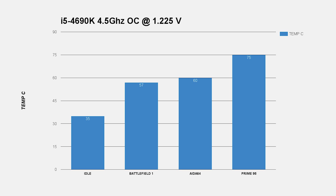Moving on to CPU benchmarks: AIDA64 generally doesn't push temps as high, and the max there was 60°C. Moving on to Prime95 torture test, it never went over 75°C, which might sound high but you'll almost never push your CPU to Prime95 limits in real use — so 75 degrees is perfect. These are very, very good temperature scores. You wouldn't get an air cooler at this price that performs as well, and this cooler performs as well as any other 240mm AIO. If you upgrade the thermal paste and pair it with better fans, those scores would get even better.